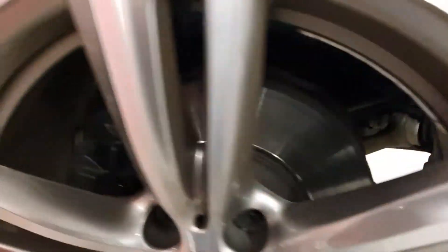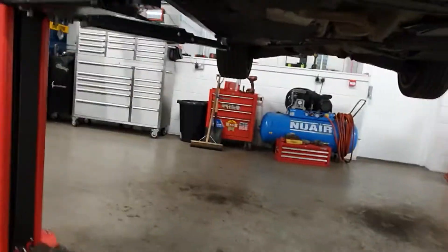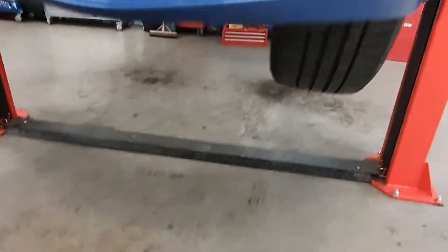It's due a service and also the front disc and pads. The pads are worn quite low and the inside face of the disc is very heavily corroded and pitted. The front disc and pads were also needed due to the warning on the dash.